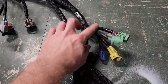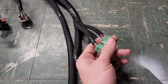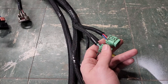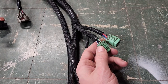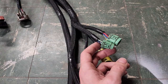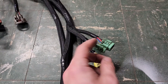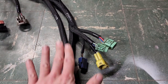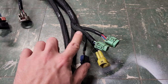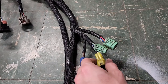Moving up to the next junction, we've got a handful of connectors. Starting with the two green ones — these are for the turbo igniter. The large connector carries power, ground, and signal wires to the coils. The other connector carries signals to and from the ECU, including the critical IGF signal — confirmation to the ECU that the coil has fired. If that one wire is missing, even if all other wires are good, the ECU will not let the system run.